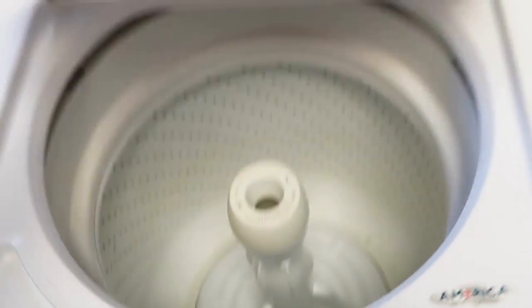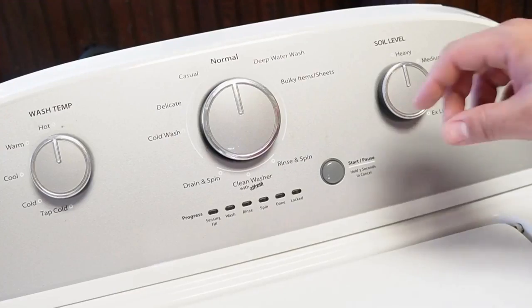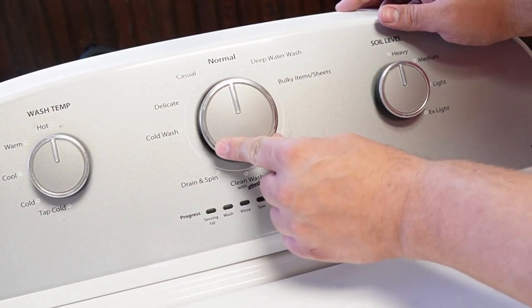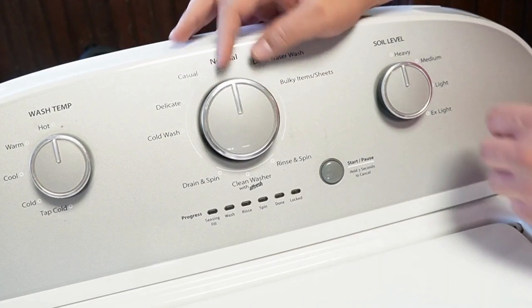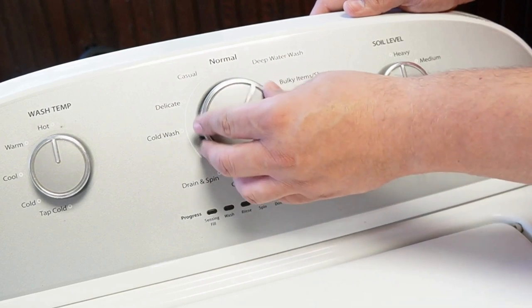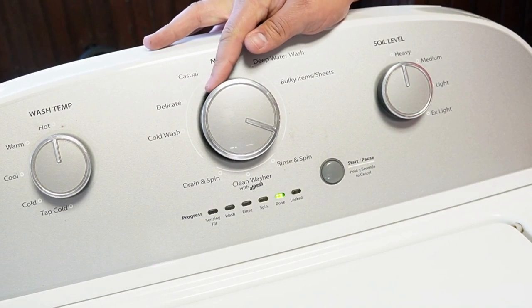Now that we've done the first reset, let's go ahead and attempt to recalibrate this washing machine through the calibration mode. This is a must-do if you've installed any new parts on the washing machine, from a board to a balancing rod. With the washing machine freshly rebooted, rotate the dial counterclockwise 360 degrees. Then turn the knob right three clicks, left once, then right once again. It should be pointing at 3 o'clock at this point. You need to do all these things within three seconds, and it may take a few attempts, but if done right, all the lights at the bottom of the control should flash on and off, showing that you've entered diagnostic mode.